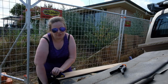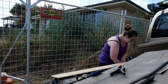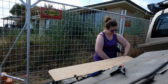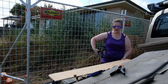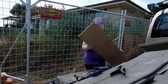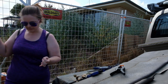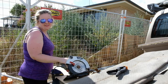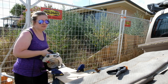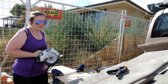The bus has some round corners at the back where we're replacing the wood. I cut the sides with a circular saw and then used a jigsaw to cut the curve. Unfortunately you can't get 15mm marine ply, so we're having to use 6mm and 9mm together to equal the depth of our current floor — which means a lot of cutting.